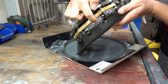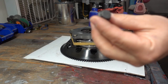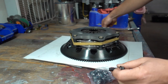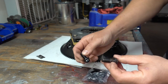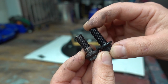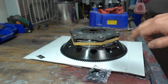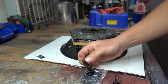Here you've got the triple disc. I pulled off one of the ARP bolts I had for my flywheel — these were designed specifically for a 2JZ — and we're going to compare them to the ones ACT provided with this kit. I can see right away that ACT's bolts are actually a little bit shorter. I'll trust their engineers on this; they gave us custom bolts to make this a one-stop install without needing to source extra parts.